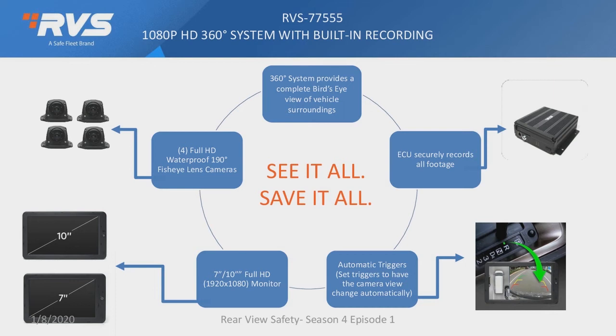So, this is for any application, and it records the footage. You can use that for insurance purposes or for any other purposes that you would need. It all gets stored securely in that ECU. This 360 bird's eye view is accomplished via, as you can see on the left, these 4 cameras. These cameras have what's referred to as a fisheye lens, which is 190 degrees, and the way the lens is situated is that they're able to cover a large viewpoint with just a single camera, and then the technology stitches those 4 views together, as we'll see in a couple of example slides a little bit further, to present this seamless look.